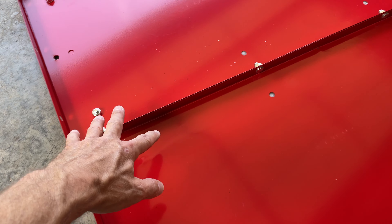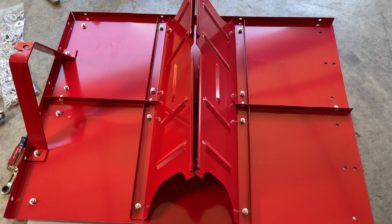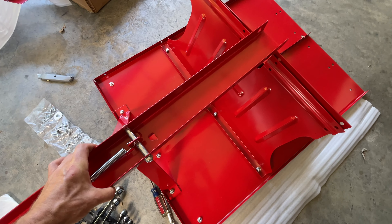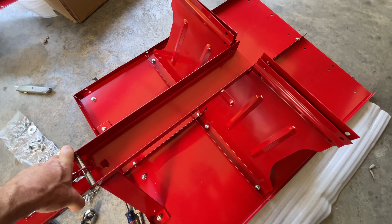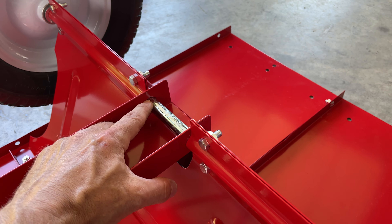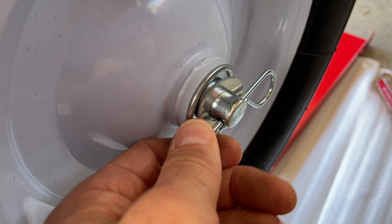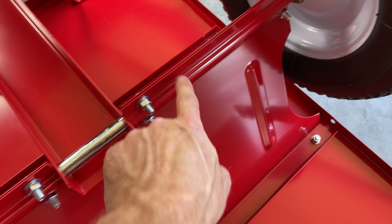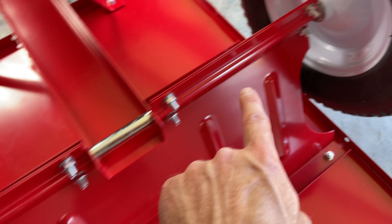It's very bolt-heavy, meaning this whole thing is just going to be a whole bunch of bolts. I'm probably a third of the way through, and you can see these things right here are the axle supports. I have this hitch mount here that I'm going to slide into place. Everything is finger tight at this point so I can move everything around to line up the bolt holes. We have the axle installed and the wheels attached. The axle is a long solid piece of steel that runs through this channel and comes all the way out far enough so that we can have a couple washers and a cotter pin. You can see the triangulation of these two pieces that basically hold this axle in place, and then these two pieces are secured top and bottom — basically eight sets of bolts.